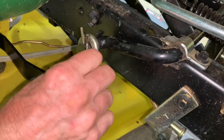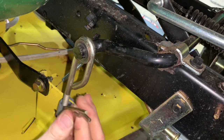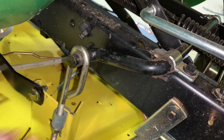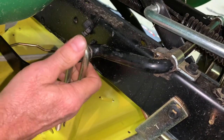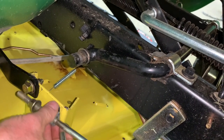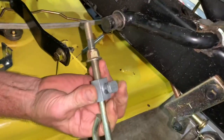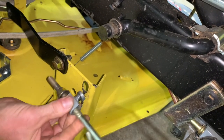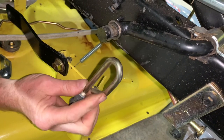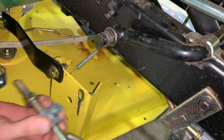The other one here — this is a real heavy duty clevis pin and these guys normally don't come out. Take that off. There's a washer here, make sure you don't lose the washer. Pick up the mower deck just a little bit — you can see there's tension on this, so if you pick up the mower deck it takes the tension right off. Turn this 90 degrees, it comes out from the hole here. These aluminum guys will get worn, but they go in here and they only go one way. Put them in like this and twist it, making sure this bar here is facing the rear — that's how they are from the factory. Take that one out and go around to the other side.